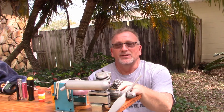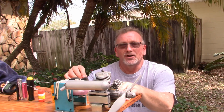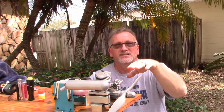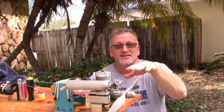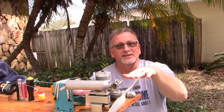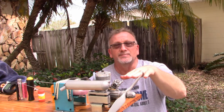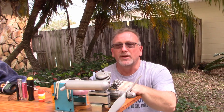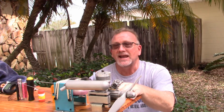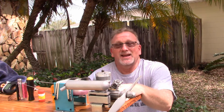As you could see, the carb is good, it works well, but when I would close it all the way, it would be at like 4,000 RPM, and then it would just kind of slowly drop down, and then I just let it sit there and find its point that it wanted to idle at. There was a couple of times where it started to drop down to 2,200, but then it would kind of rise back up to around the 2,800, 3,000 RPM point, which is basically where I had it initially or ideally set for, and then it just sat there and idled.